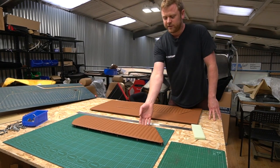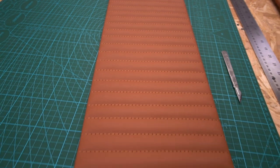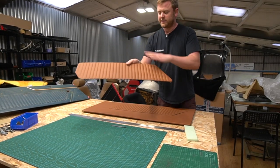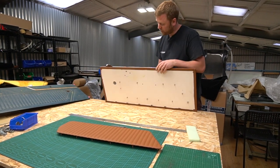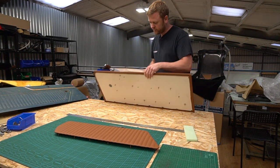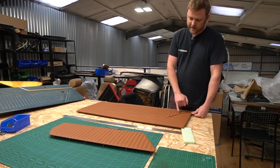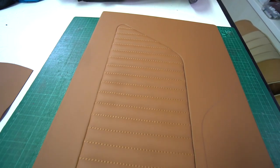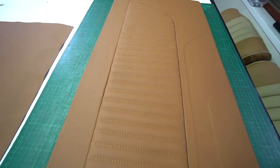So what we do is create another separate panel. This is actually made in steel and we've spot welded studs on the back of it. The ribbed section is then wrapped all the way around that and bolted through the main panel. We've used 5mm thick foam here so it has quite a significant recess that it sits into, making it a lot more flush so you don't see just the edges of this panel.